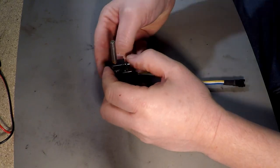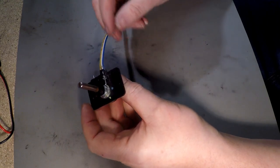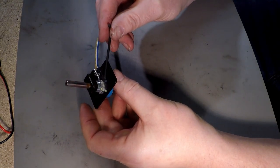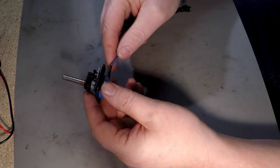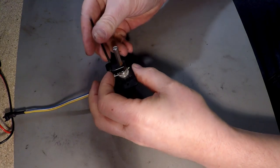Okay, that's just now got the throttle pod on a workbench, and we can clearly see now in more light that there's corrosion round about the spacer, the spring washer, the nut, even some corrosion on the spring here as well, and here it's clearly visible. So water damage.